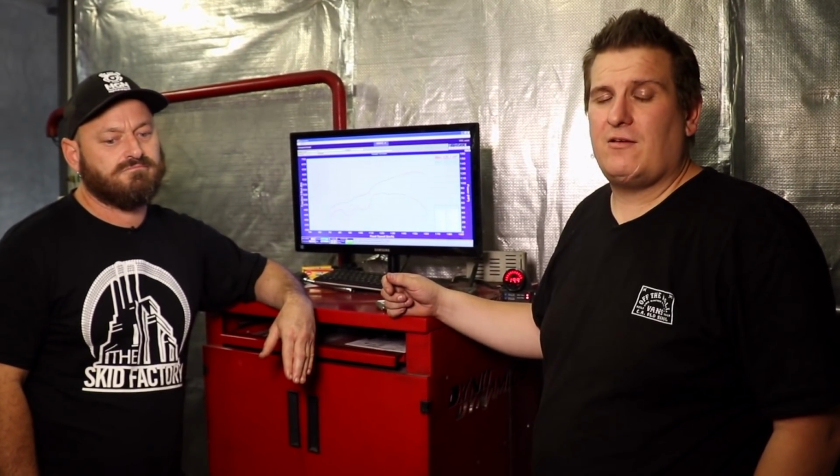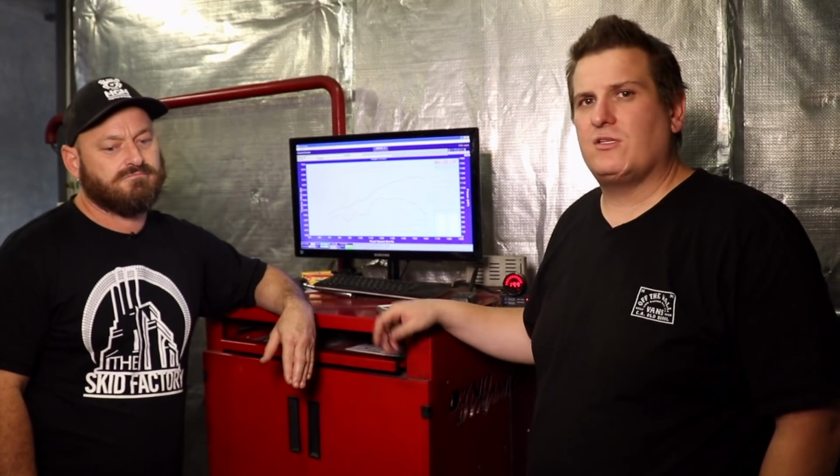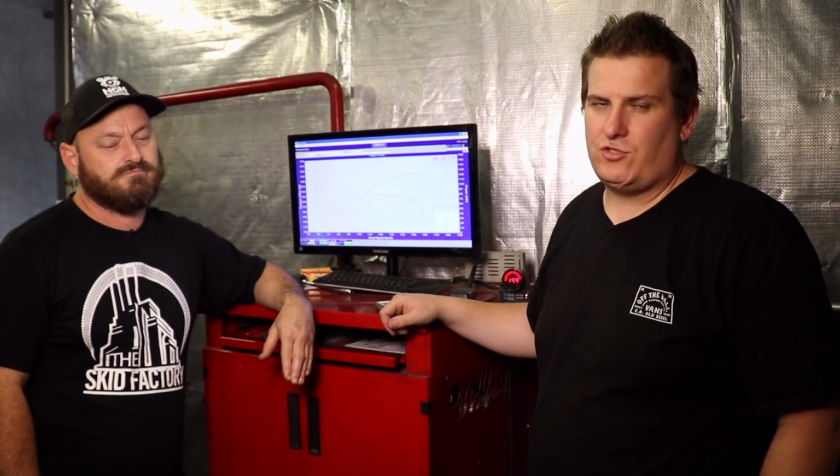So that's next. They're a set of throttles that I've been working on with a manifold that bolts to the engine. Once we install those, we'll go through the process again of having the fuel map tuned to accompany the ignition map that's just been done.